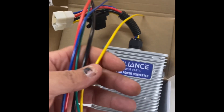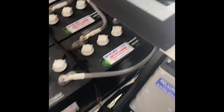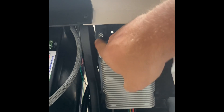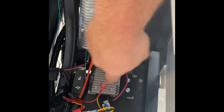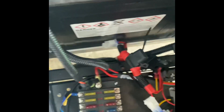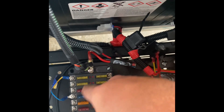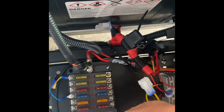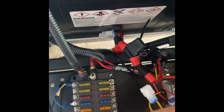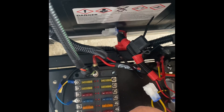When I put one of these in I always put it in with some type of fuse block. On Joseph's cart I made a little bracket, got that up out of the way nice and neat. I still got to tuck my wires and there's another reducer for the storm body that runs all the stuff off the storm body. The red wire comes up here to your positive, the black wire comes to the negative, and then I run an extra ground wire to the pack just because I'm crazy like that.